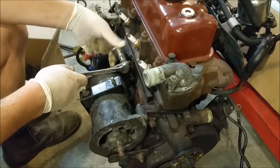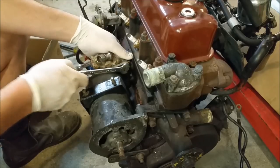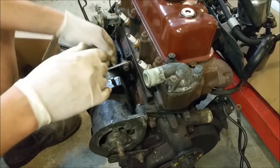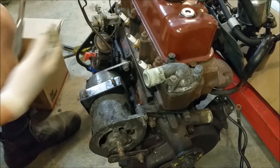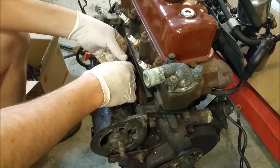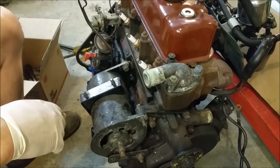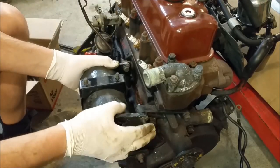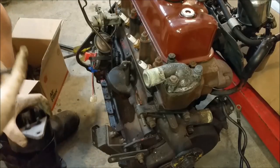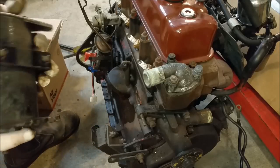I hate it when the threads are too tight to do by hand but too loose to do with a ratchet. BMC was big on fine threads - quarters and five-sixteenths normally, with the odd three-eighths. I'll just take all these out. You can get these readily - they're actually really cheap. Imperial stuff's a lot cheaper than metric in this neck of the woods. That should just pop out now. Little generator - that works really well. So we'll give it a paint job.